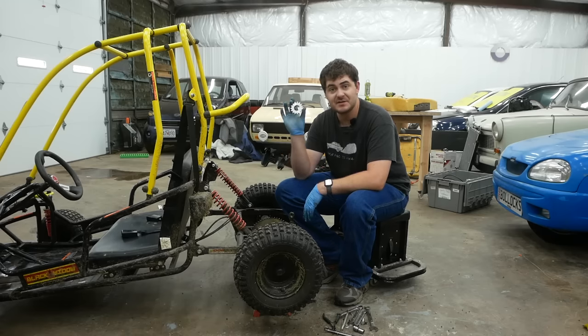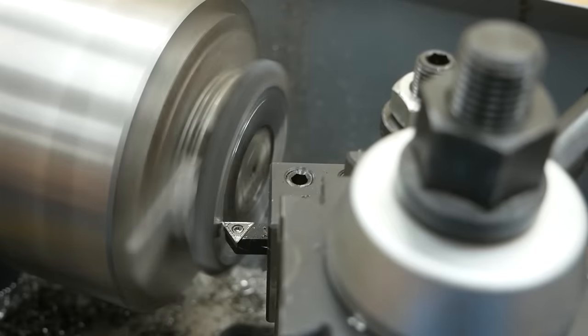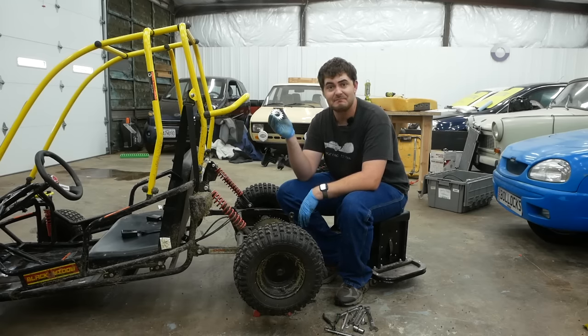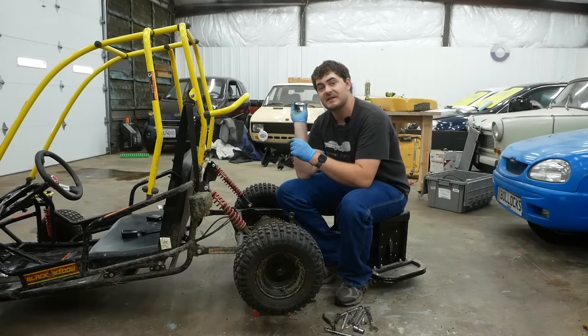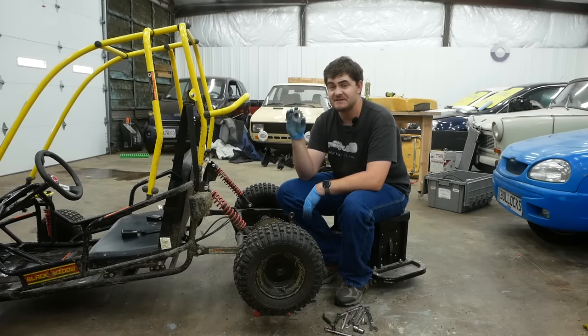I found this little piece to use as my drive sprocket, and it's shiny because it was a little bit too wide and the chain didn't fit on it, so I had to turn it down on the lathe to make it a little bit narrower — and now it works perfectly. I thought I bought that mini lathe and it was going to be completely useless; well, now I've used it... once. This sprocket is 15 teeth, compared to the original 10-tooth sprocket on the engine, so it will be a little bit higher geared than before. Hopefully that won't be an issue.